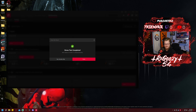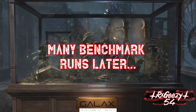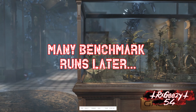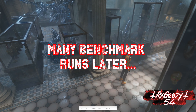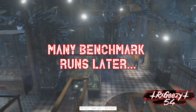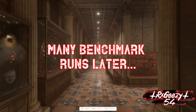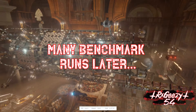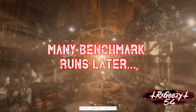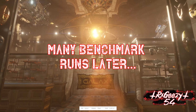I don't know exactly how it's going to go long term, but let's try running a Time Spy after letting it cool down a little. Liquid metal's working great. I'd only say do it if you're overclocking — otherwise it's a lot of work and risk just for a couple degrees off. Plus, if you're running a liquid cooling loop, it's going to make the room your computer is in a lot hotter because it's exchanging heat a lot better. But I'd say this was a success. Let me know if you want me to do a review on the Thermal Grizzly nail polish conformal coating. Catch you guys later.